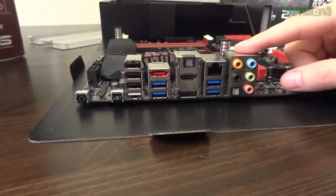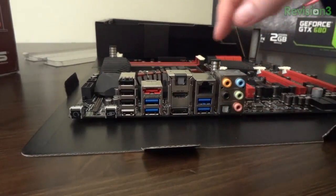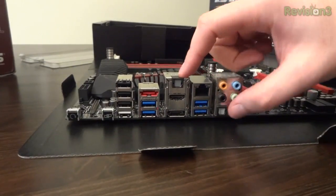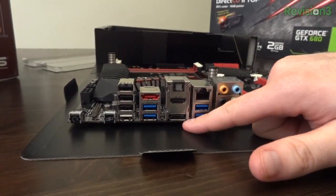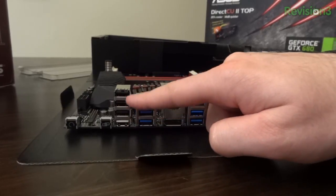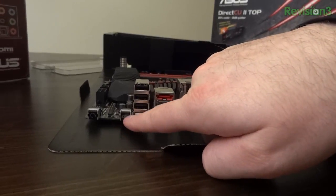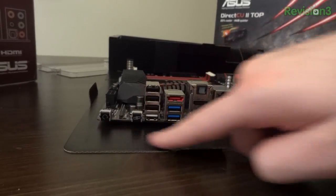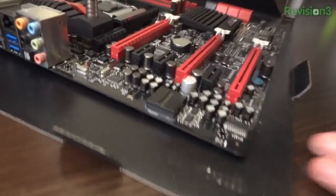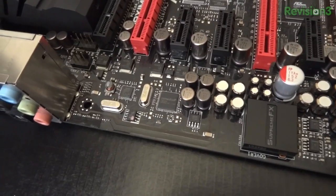Here's a closer look at the back panel on the motherboard. You've got your analog audio as well as digital audio, your network Ethernet port, two USB 3.0s, another digital audio in and out, an HDMI port, DisplayPort, eSATA, two more USB 3.0s, and your regular standard USB 2.0 ports — although the bottom port here can be switched to ROG Connect. This is your ROG Connect on/off switch, and on the far end you have a Clear CMOS button. The sound portion happens right down in this region here, and you might be able to make out the line that represents the EMI shield I mentioned earlier.